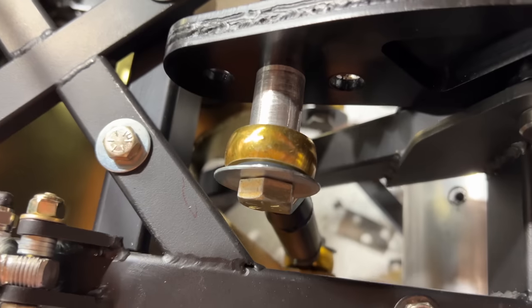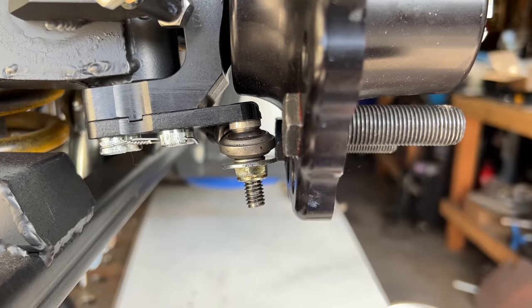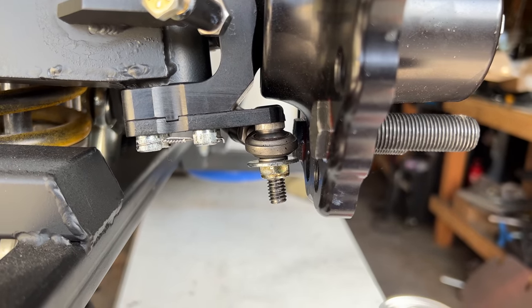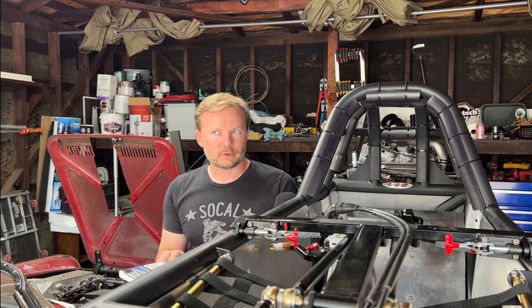But just in case they don't stay in one piece, they also require a washer on all rod ends, so if it does come apart, the important part stays roughly where it's supposed to. This rod end here is actually rated for a thrust load of 2,000 pounds, and if it ever sees that — well... The rules are not really there to ensure a safe design; they're there to make it kind of hard to have a bad design. They're also there so safety inspectors don't need a master's degree in engineering and don't have to take your word on the thrust rating.